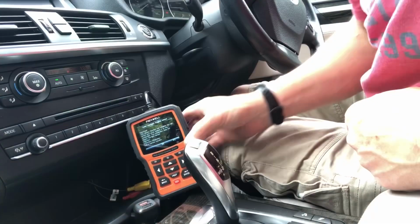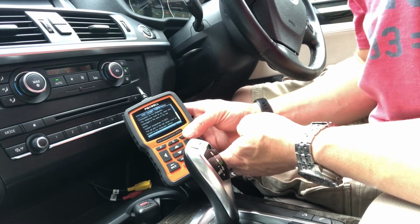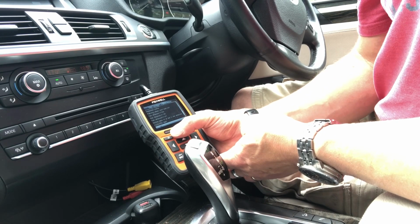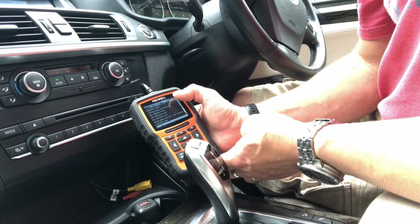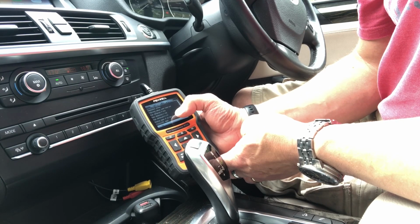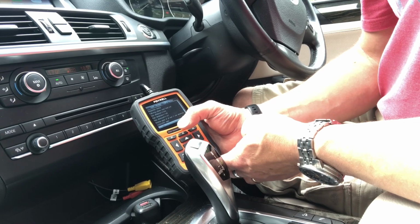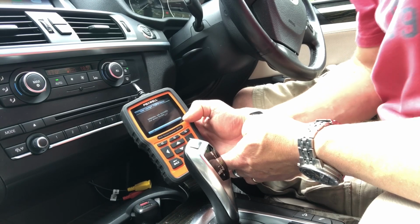Yep. So perform the initialization. Yes. Prerequisites, yeah, okay, we're all happy with that. Okay, 3 rain sensors, blah, blah, blah. Oh, now we've got some changed ones. We've got rain distance 1,200, rain distance 1,199, rain distance 1,197. Nominal value of at least 2 rain sensors, 1,200 plus or minus 50 digits. Which actually I think might be better, but let's have a look. Successful. End service function. Yay!